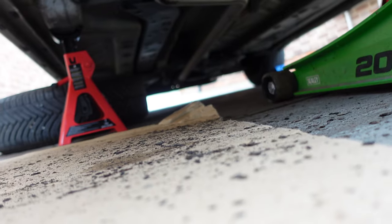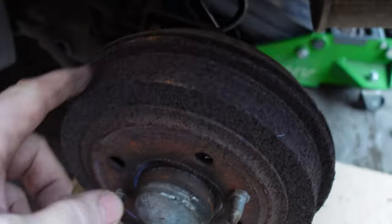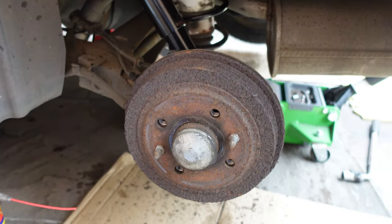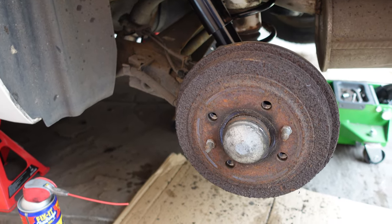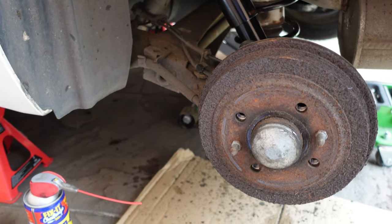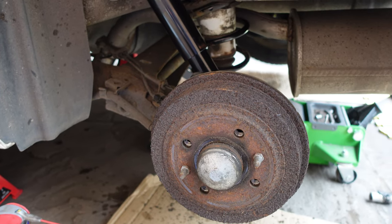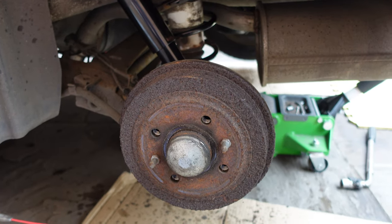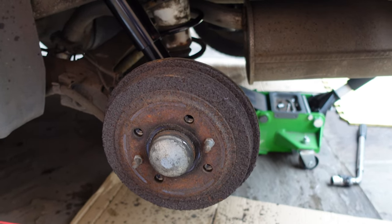So that part of it done now. As I say, all I've got to do is just give this a bit of a de-scale — give it a bit of a brush with a wire brush, just clean it up a bit. Put the wheel back on. I'm not going to put the trims back on for now because I'm going to give those a good clean back and front. But this is all done, all cleaned up, all nice. Wheel can go back on. Then service is done. And I know, at the point you're seeing this, the clutch would have hopefully been sorted out. But I've still got to do that — that will be later on this afternoon, which as I say you would have already seen on the previous video.